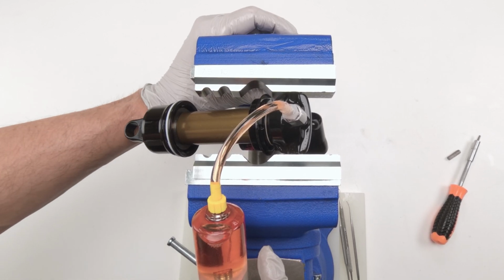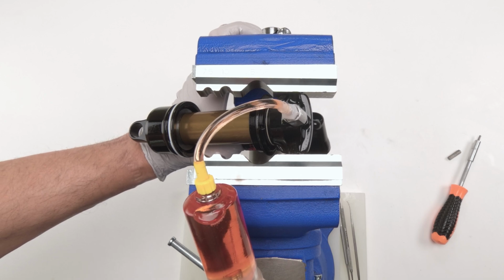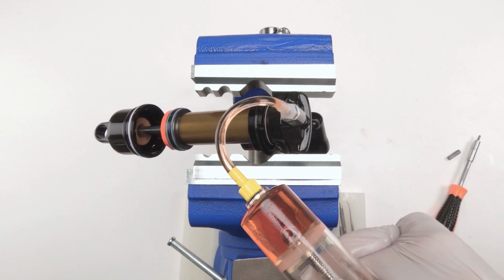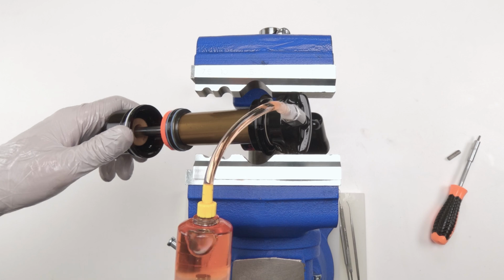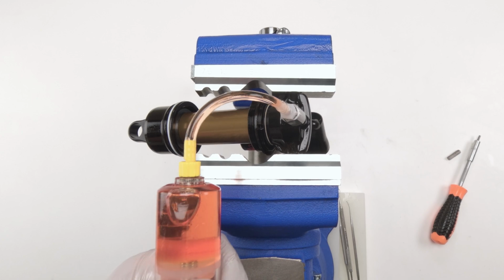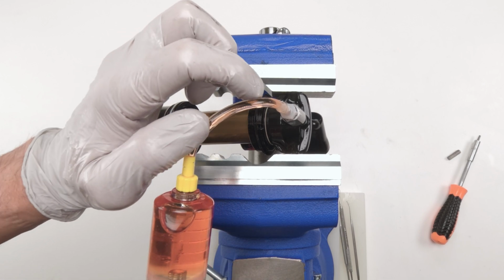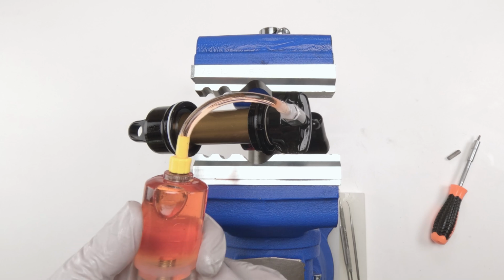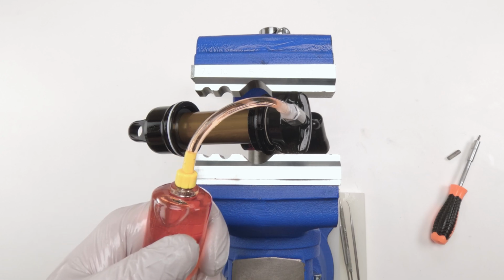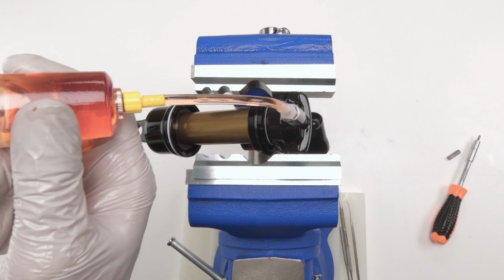Bring this guy in. See if we can get him out. Push the IFP in all the way again. Okay, now we're going to force them both out. The IFP is coming out. Now the other side is coming out. Let's see that little bubble? Again, there you go. That's why you pulse vacuum. Don't pull vacuum on them. Just pulse, pulse, pulse vacuum, so you could get stuff like that to get agitated out of little spots. And make sure they come all the way up to the top so we don't put them back in.